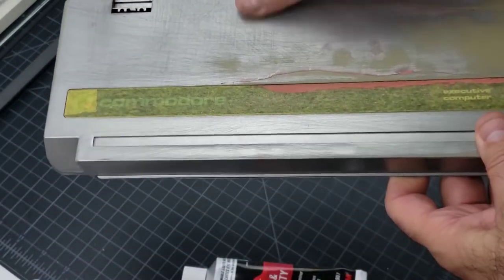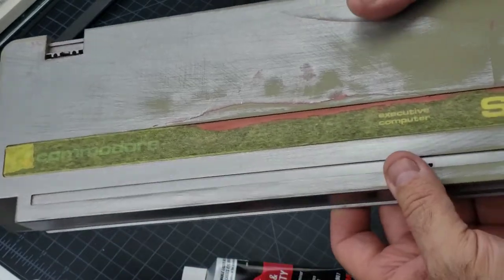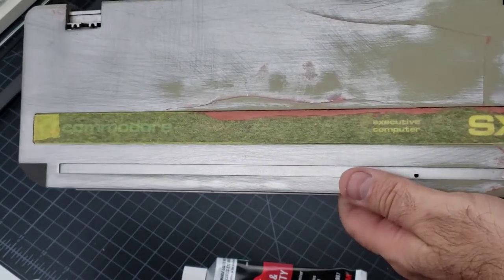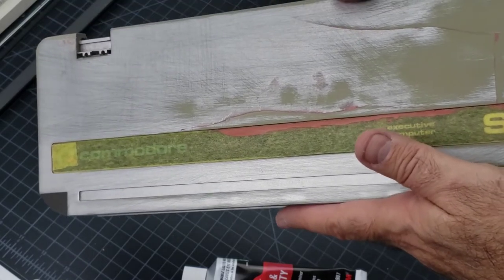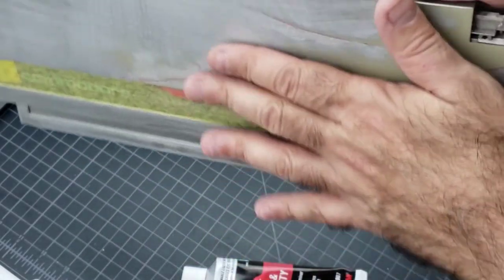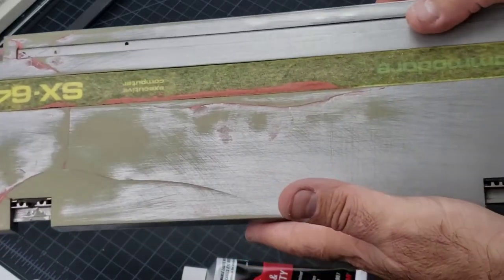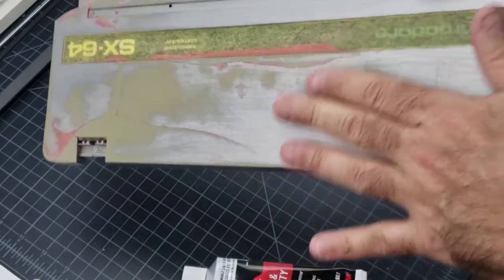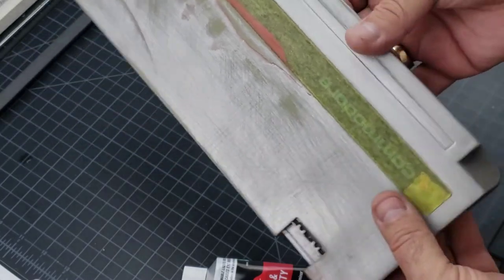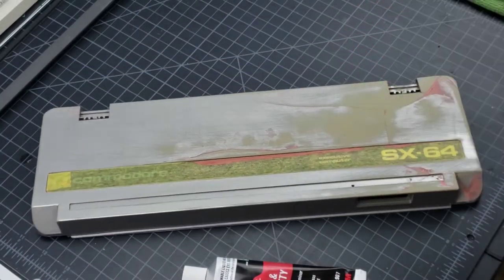After the fine sandpaper — to take away all the scratches the medium paper left — we're going to primer it in gray. The primer is a fillable primer, so it'll fill in whatever little things are left, and then we'll wet sand it. We may need another coat of primer. The primer will show all the imperfections — it doesn't hide anything. After priming and wet sanding, it should be really smooth to the touch. By that time our final coat of paint will get here and we're almost to the finish line. Stay tuned.